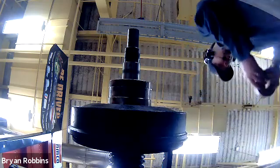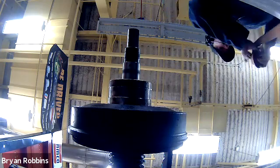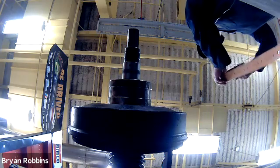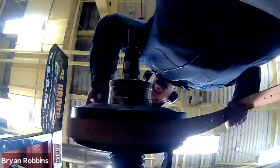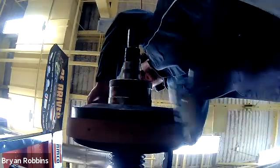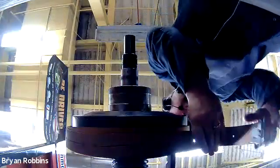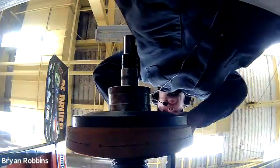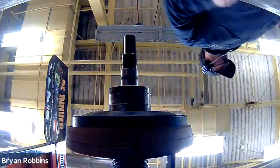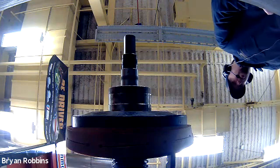Just like with the other tool, we need to install the vibration belt — taking care of these vibrations and making sure that this thing doesn't rattle as it's being machined. Very important. We'll just take and wrap the belt around the outside of the drum and install it so it's on there tight. We don't want this thing to fall off while it's rotating, because that can come out and hit somebody. And now we have a drum that's ready to be machined.